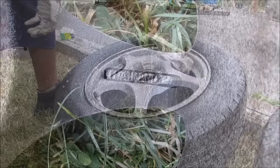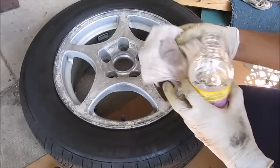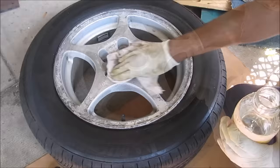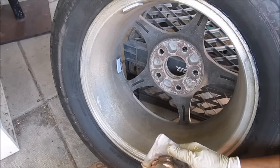Once you finish rinsing, use a clean cloth and dry the wheels. Now with the wheel clean I can see that this Honda wheel was made in Thailand. So now that the wheel is dry I'm going to use a little bit of paint thinner and wipe down all the surfaces of the wheel to remove any remnants or contaminants of grease or dirt. Again, make sure you use gloves to protect your hands. You're also going to want to wipe down around the surface of the wheel so that the tape sticks better when you mask it off.